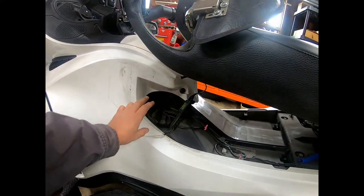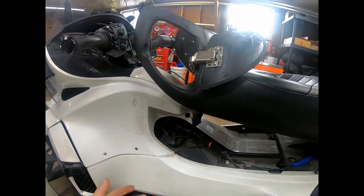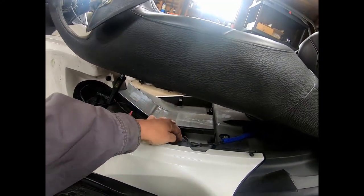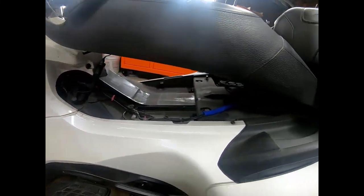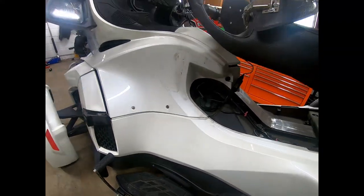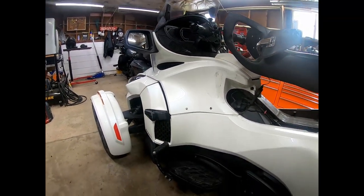With the seat off, there's the fuel cap right there, and that's where she can plug in her phone and heated gear — not ideal placement but it works. This wiring runs back and feeds the trailer hitch lights direct from the battery. I put a splitter in there so it runs from the battery to the trailer lights, up into the seat and out. The relays are in the corner back here and they're not hard to install. I think I need a T27 Torx, so let me get some tools and get busy.